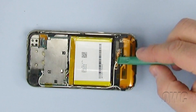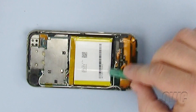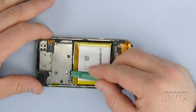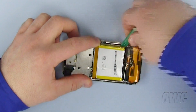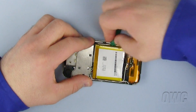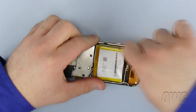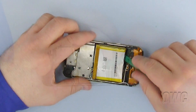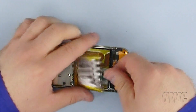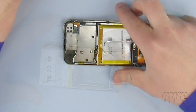Now set the back of the iPhone case to the side. The next step is to loosen the battery. Be very careful not to damage the very small and delicate antenna cable here, as damaging this cable will render your iPhone useless. Also take special note of the power, ground, and battery charge indicator connectors — if these are damaged at all, your iPhone will be completely ruined. Stay away from this area with your nylon pry tool. The battery is glued down, so use your nylon pry tool to slowly and easily pry it loose. Warning: do not pry up on the battery over the antenna cable. The old battery will get a little deformed as you slowly and carefully pry it loose from the iPhone. This is natural.